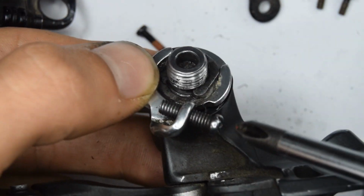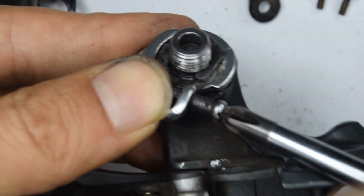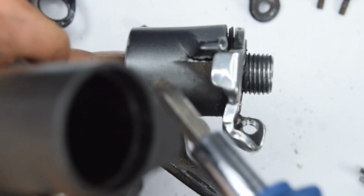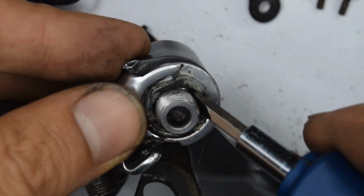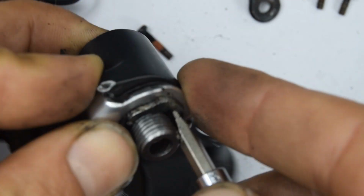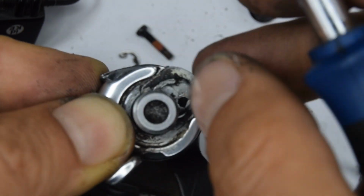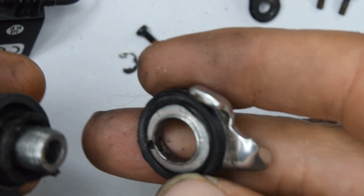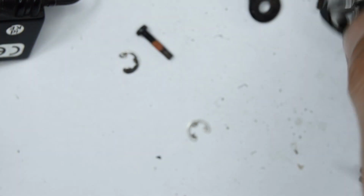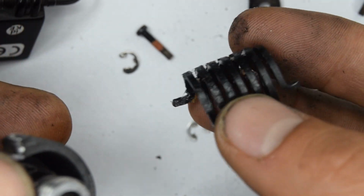Let's work on the B pivot top knuckle, so you can definitely open this up with no issues. Take off that screw first. And actually this derailleur was damaged right here. You can see there's a crack, probably from a shock. Here there's a C-clip. Let's remove that. You'll need to position that C-clip into the right location where there's the opening. My one's just undone itself already, and so on the inside, we have this plate with the seal. There's the spring, small tip facing towards us.